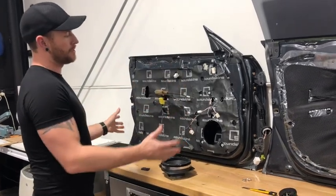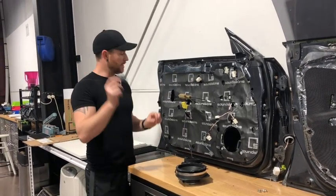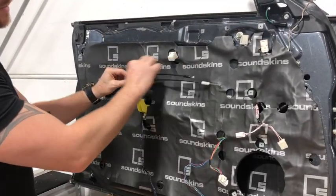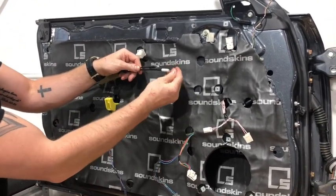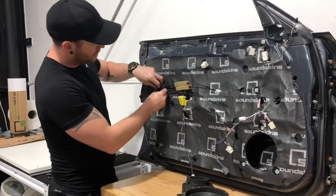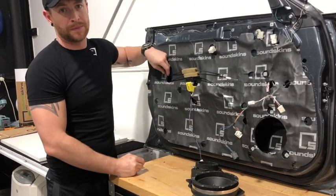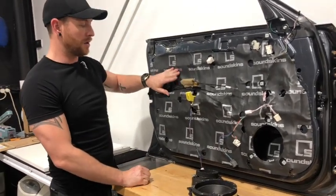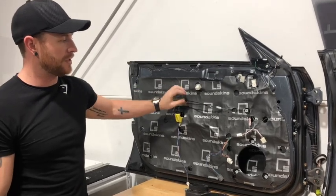Make sure you go through and stick it down really, really well so it's never going to come off. That is the finished result. We're going to do a couple of small additions and test our trim on. One thing to note: for these cables — not on this particular car because this is a Subaru using cables — but some cars have rods that actually move inside the door. The best way to handle that is to take a secondary piece, put it behind the sound skins facing into the door. If you place that behind there, it stops it being sticky and allows those cables or rods to move freely without getting stuck and tearing the material. You can cut off little square sheets and put them on the inside of that panelling.